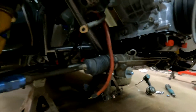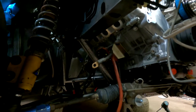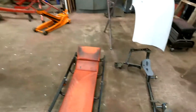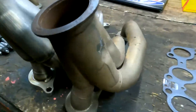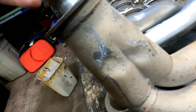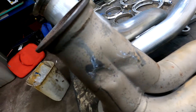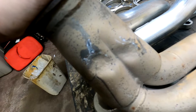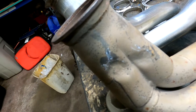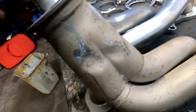Got the rack back in. Steering shaft is currently hanging down. The next thing we ran into after putting this K-member in is that the passenger side header still didn't fit. Originally that header was hitting right here on the old K-member. But upon further inspection, you can see where they had indented it — not only was it hitting the K-member, but it was also hitting the frame rail. I'm assuming they hacked up their frame rail pretty bad to get these to fit. This came from a New Edge Mustang, which would be 99 to 2004, so they probably hacked up the frame rail and indented the header as well to get it to fit.